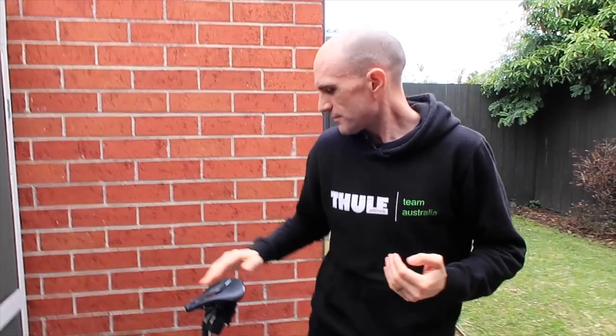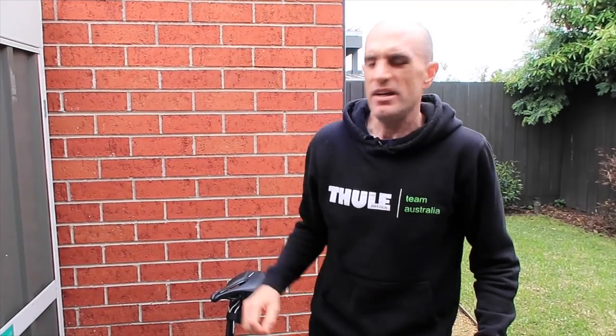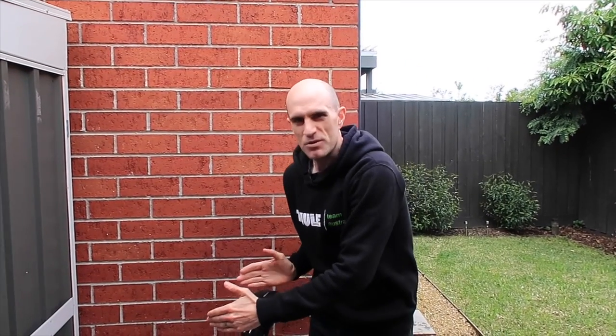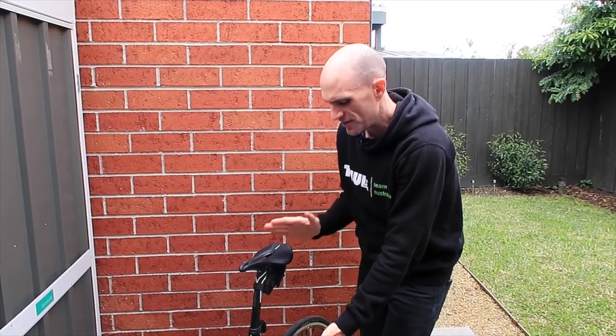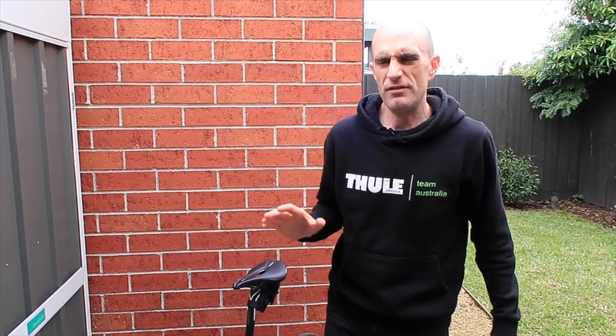The other week when I was talking about the hire bike I had over in Borneo, I mentioned there was a simple way to find out the best fore and aft setting of your bike, knowing your measurements for that. The first day I had the bike, I was really far back, really reached out, it didn't feel any good at all. I overlooked it because I was too excited about getting up the hills and doing some epic mountains — the saddle wasn't positioned right. I had to move it a little bit more forward to suit my position. I had the height right, I knew 77.5 was correct in saddle height, I just didn't have the fore and aft correct.